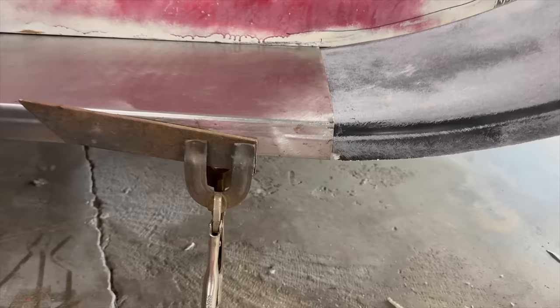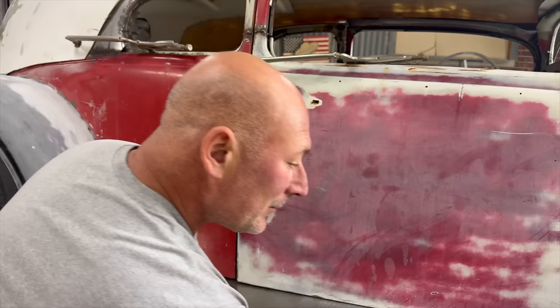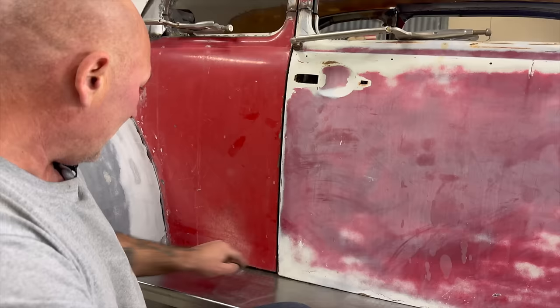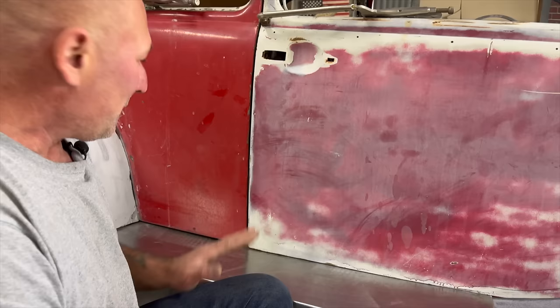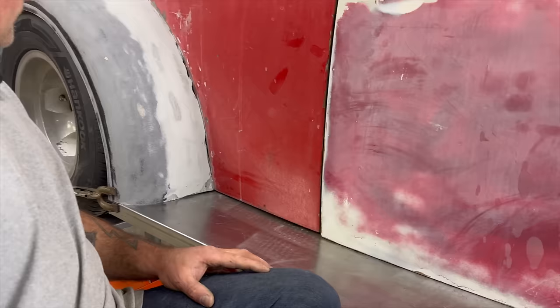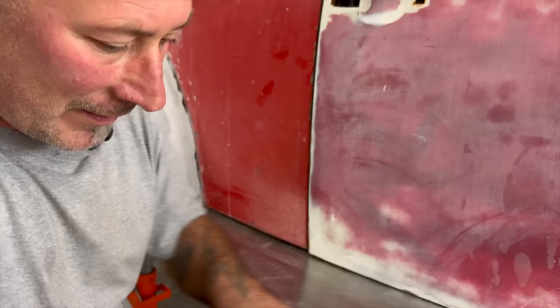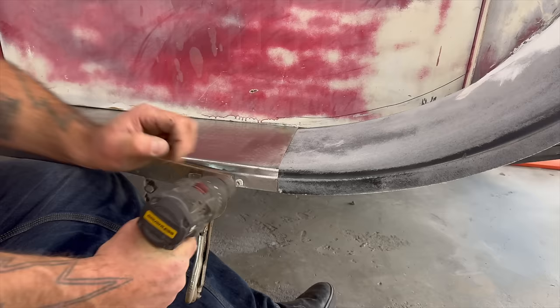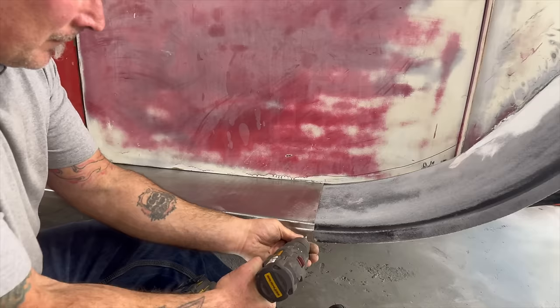I like it. So if we could open this door we would, but there's a whole story that's going to happen there. I'm going to put two temporary rivets here because this steel is going to stay with the car during the fabrication. The fender is going to detach for finish work and so is this one — I'm going to weld it along here to that. The door is a whole other operation. Let's get into that, and then I'm going to make another fastener here out of sheet metal. Let me sand this back, put a couple of tacks in there, and then I'll get a couple of rivets for there. I was going to rivet it, but then I thought — if I rivet it, I'm going to have to drill it out. So a couple of self-tapper screws that'll pin it for the time being.